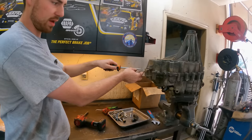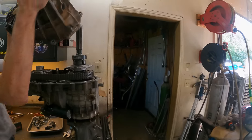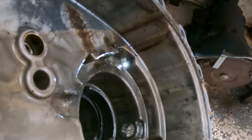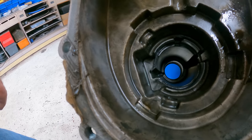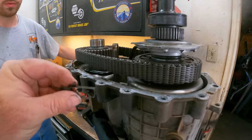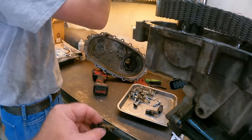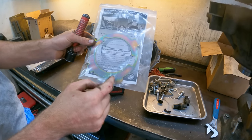All unbolted — these are really nice, they give us a perfect little split point right here and another one right on the other side so we can just pop it apart. Pull that right off. You can see each spot right there, right there, right there where the pump has rubbed through the case — little hole right there. Yeah, I think all of them are that way. Thank you New Venture for being so cheap.